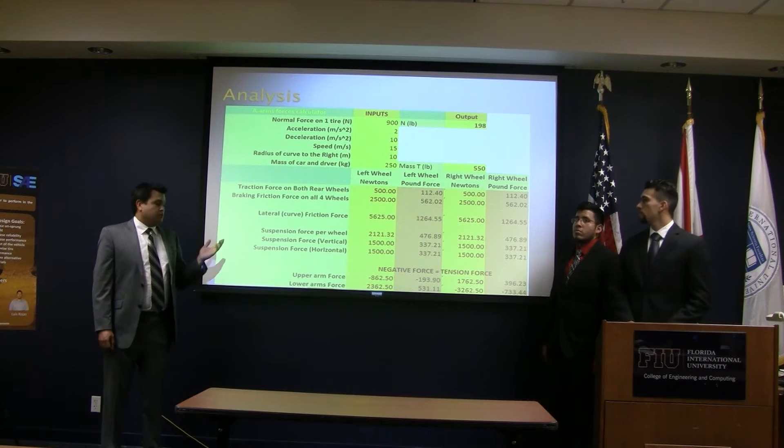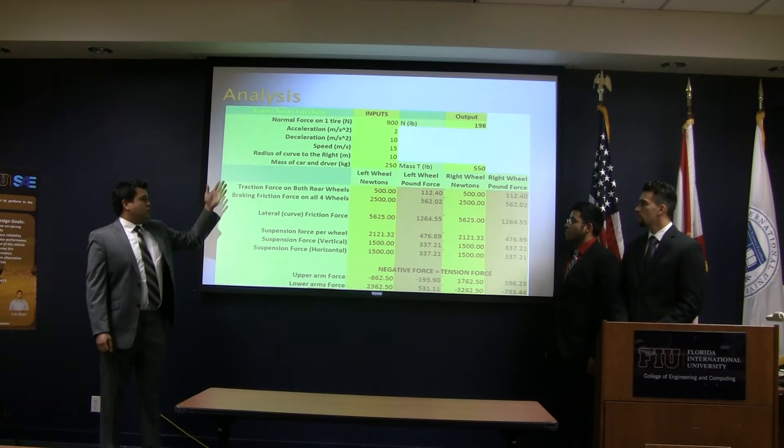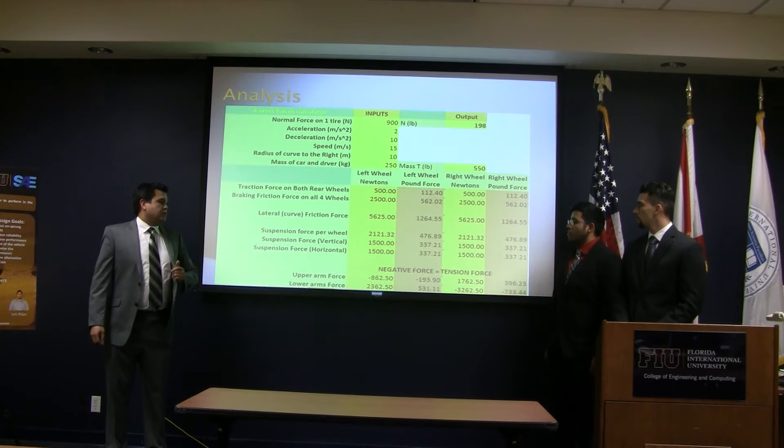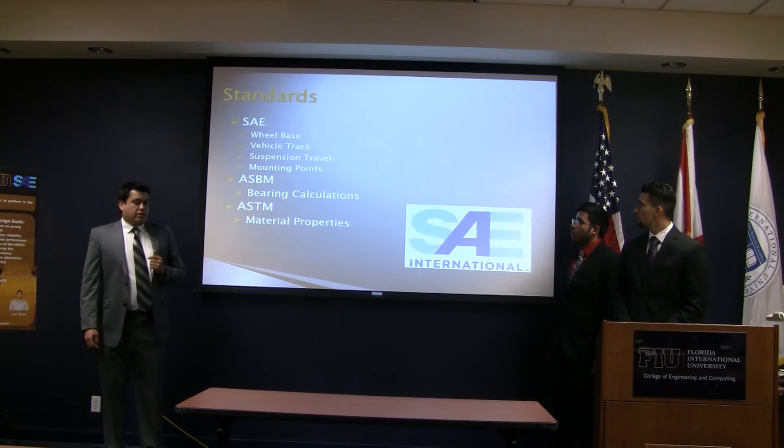Here are some of the internal forces of the suspension A-arms. Everything translates from the wheels to the uprights, to the hubs, then to the A-arms, and finally to the chassis. We can see forces going up to 500 to 700 pounds in tension and compression. However, due to the geometry of the rear suspension, the forces go up to 1,000 to 1,500 pounds in tension — just because of the geometry.